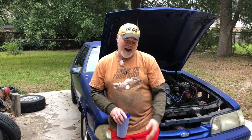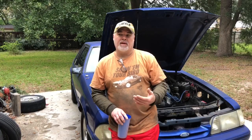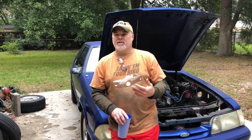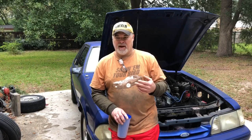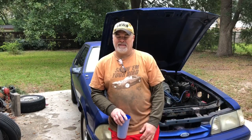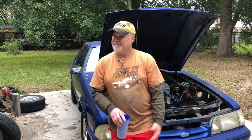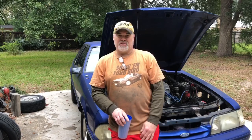Fortunately, Michael and Kevin pointed me in the right direction. The good news is we got it all back together. We fired it up last night - it was getting dark but it runs. The plugs in it are pretty dead though - I fouled them a couple different times. I'm going to pull these out and clean them. I could go to the auto parts store and buy some plugs, but I've ordered some. With the gasket situation I'm getting low on gaskets and stuff, so I sent Rock Auto a bunch of money - ordering intake gaskets, head gaskets, thermostat housing gaskets, and timing cover gaskets.